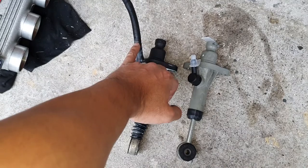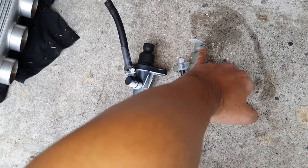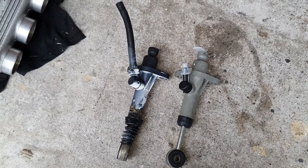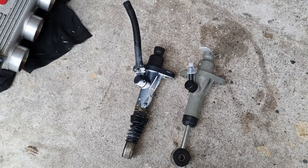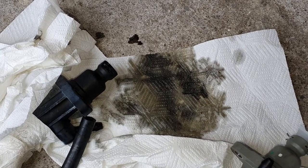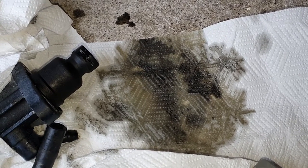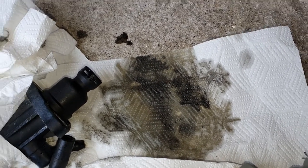We're going to use the new clip when we install, and remove the plastic protector as well, and then bleed everything — that'll probably be the fun part. I have George to help me out. Also, just check out all the dirty fluid that came out of the master cylinder — it's really filthy. I'm definitely glad I did this job even though it's a bit of a pain getting under the clutch pedal.